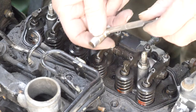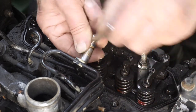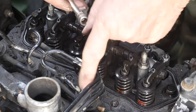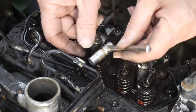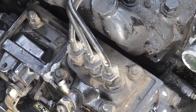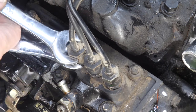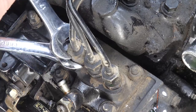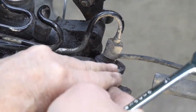These bolts here are 7mm but I don't have one, so I'm using the 9/32nd. We need to break this little guy loose so the lines can be separated, especially to get the injector line off of number 3. It's strange thinking about these cylinders numbered 3, 2, 1 — just odd, not used to it. When you crack these injector lines, you want to use two 17mm wrenches: put one on the fitting that's in the pump and drive the second one loose, leaving the one in the pump.